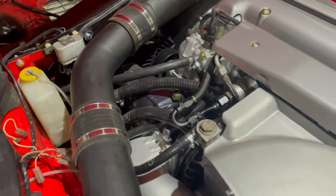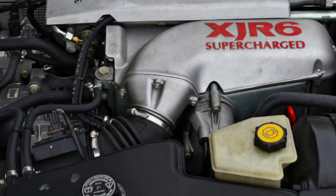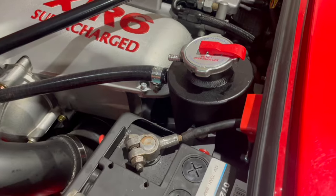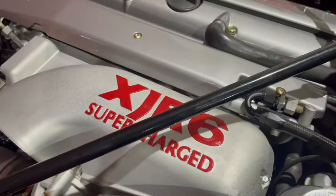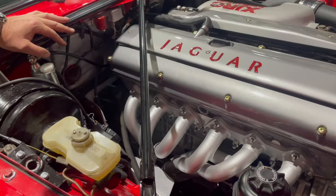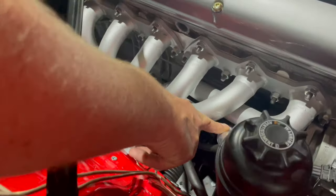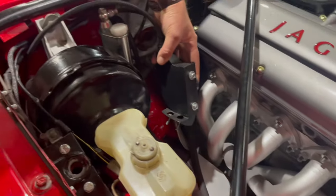Some of you will point out that previously I had a standard coolant expansion tank — when we built up into the engine bay there just wasn't room for it, so that went. I've put in a race-type coolant expansion tank up on the bulkhead, which saved room, made the plumbing a little easier, and was just the way to do it. Fuel lines are all plumbed in on dash-six high-pressure fuel line. The wiring is all in and done engine-management-wise. On this side of the engine bay we've got the power steering reservoir running close to the exhaust, but fortunately the exhaust is ceramic coated and we've put heat shielding on it.